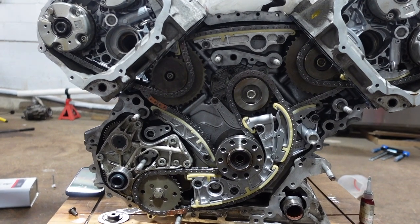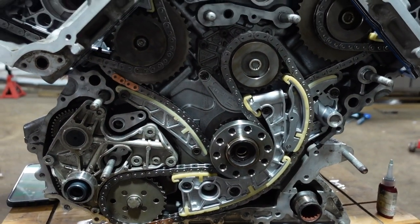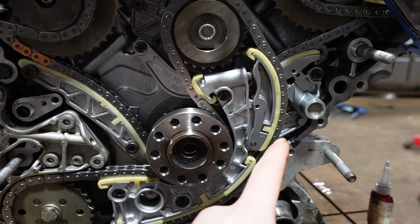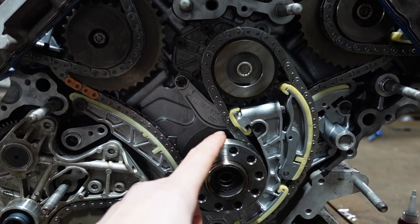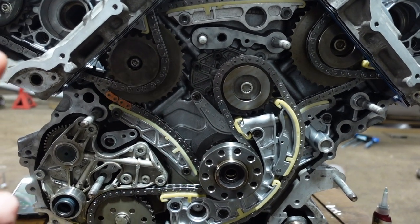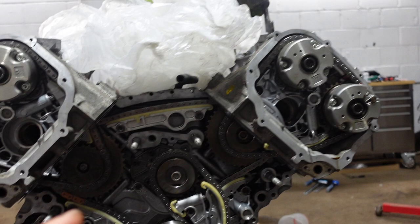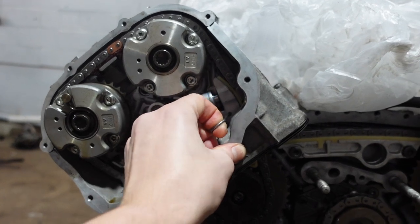I now have all my chains on - what a pain! It is impossible to fit a guide without fitting the chain first, so the amount of things I've fitted and had to take back off again - just an absolute pain. I've already pulled the pins out of the tensioners for the spur drive, the oil pump drive, and the other chain at the back which just connects both heads to the crank - they don't need to be timed. I don't need to time anything at the top here either because I've already locked my camshafts in TDC and my crank is already at TDC.